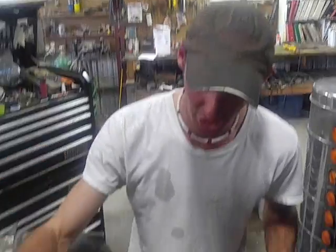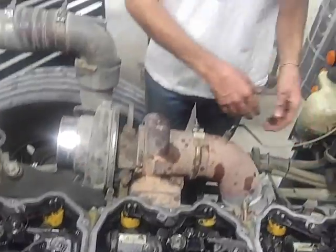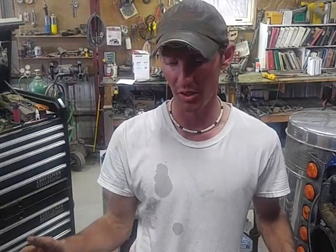Put your valve covers back on. And like I say, if you're gonna cheat, slip the front one in first, then the other two, get your intake back on, and you're good to go. Make sure you don't have any leaks, go from there. Now if something comes loose later, tear it apart, see what came loose, get it fixed as quickly as possible.